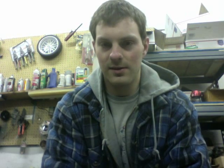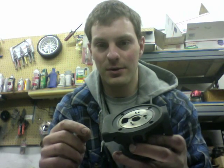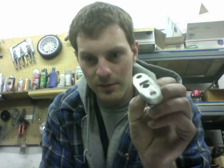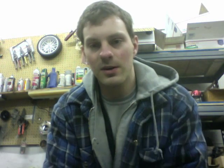Real quick, I just want to help you with the diagnosis: if your turbo is blowing oil and you don't know why — maybe you rebuilt it three or four times and you have the same result — the first thing you need to check is: are you using a restrictor? You shouldn't be using a restrictor. The second thing is the oil drain — what is the inside diameter of your oil drain? The main problem is that oil drain sizes are too small. The factory drains are usually around 16 millimeter, which is fine.